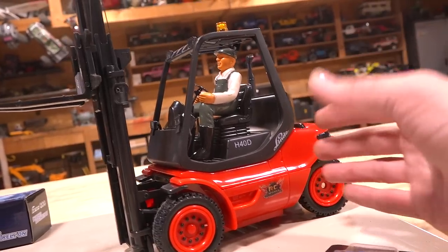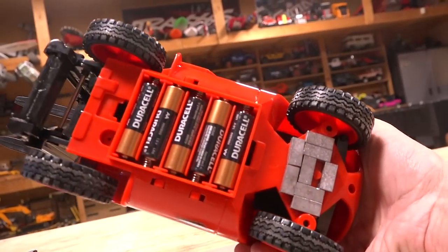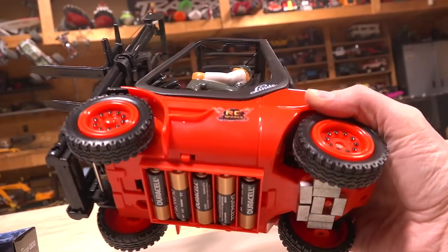This little model doesn't have a voltage monitor, and you've got to be careful with LiPos — if you run them too low, they can become dangerous and unstable and you can ruin the battery. But with 3,800 milliamp hours, that's going to give you a ton of runtime, so I'm not going to worry about running out. This will have constant power, but the problem is I have to modify this to get it in, which means I've got to cut this out and get rid of that whole battery pack.